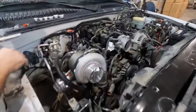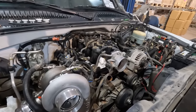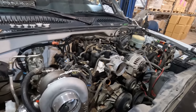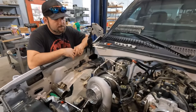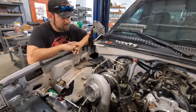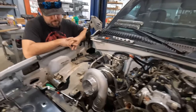We've got to swap our fuel injectors in, and space up the rail a little bit because our injectors are longer than what we've currently got in there. We got some, again, Chinesium injector adapters that we are going to toss in there. What else do we have before this turns up and functional? Pressure checking, a bunch of stuff. Boost controller, that's super simple. We could go off of the nipple. It's literally just right here, it goes straight from there to there.